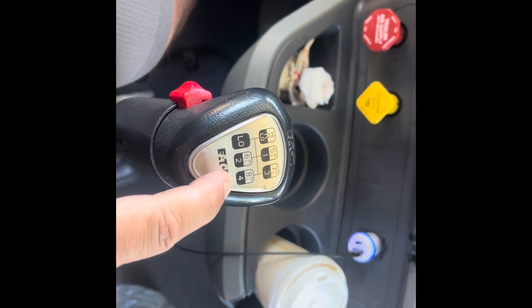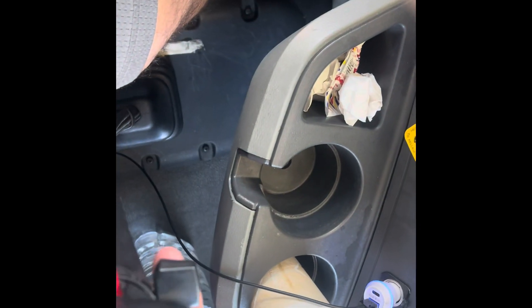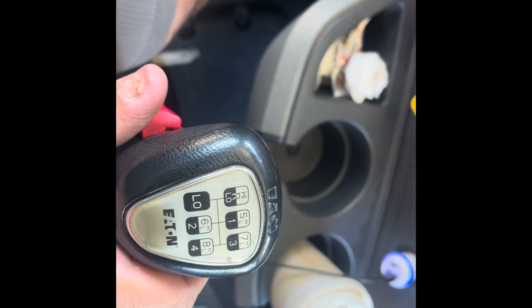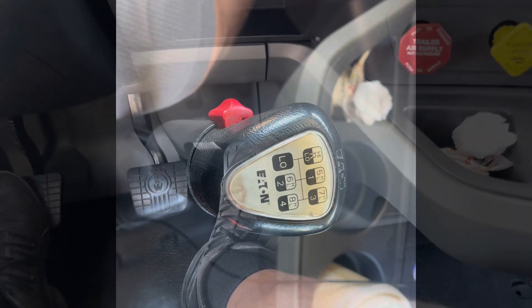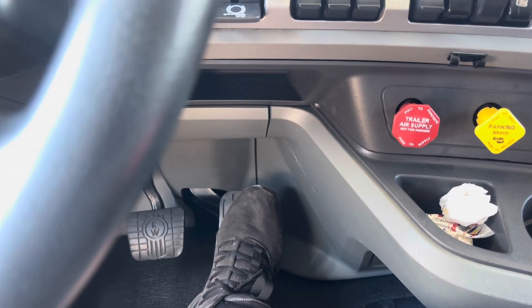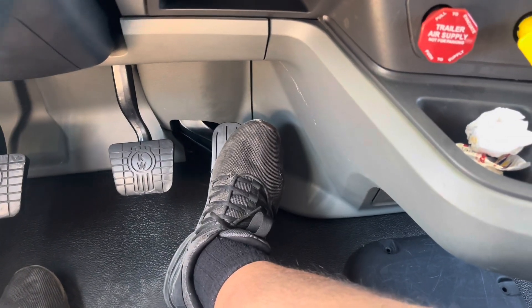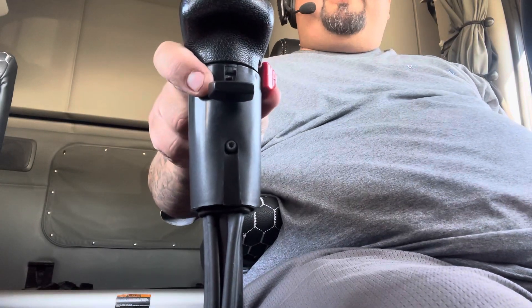This is the one that goes up and starts the high gears, and this is the one that's five-high, five-low. Every time I'm hitting the high gears, I let go of the acceleration and then accelerate again so the gear can kick in. We're not double-clutching — we're just using the accelerator.